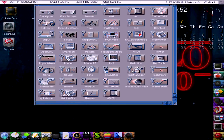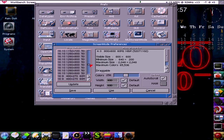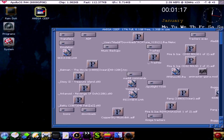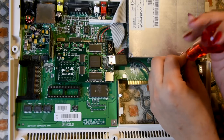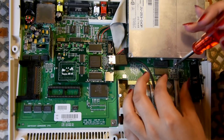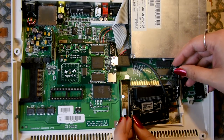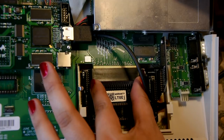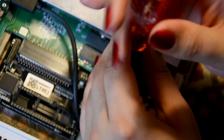I always wanted a 68060 processor, but now I have a 68080 with RTG. There's a demo I'd seen that requires a 68060 accelerated Amiga, and it just didn't work — that's when I realized I don't have enough chip RAM. It's just the usual stock 1MB on my 600. I recently bought a 1MB upgrade for my other 600 the same time I got it recapped, and I read that it doubles the chip RAM, not the fast RAM. So I quickly installed it, got 2MB of chip RAM, and had that demo working perfectly. Fantastico!